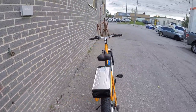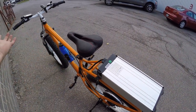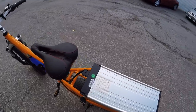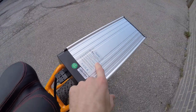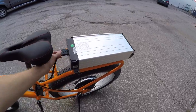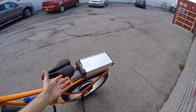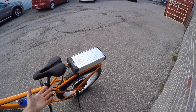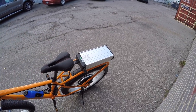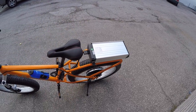One thing I don't like about the battery setup is that you have to leave the keys in when riding — they can jingle around, though they're way out of your way so you won't kick them. These batteries are a little easier to find and replace. This one is a 48 volt, 10 amp hour lithium-ion. If it's cold and snowing outside, I'd recommend taking it off the bike — just unplug it, slide it off, and store it inside in a cool, dry environment. Extreme temperatures aren't good for it. If you're not going to use it for a while, store it at about half full so you're not stressing the cells.